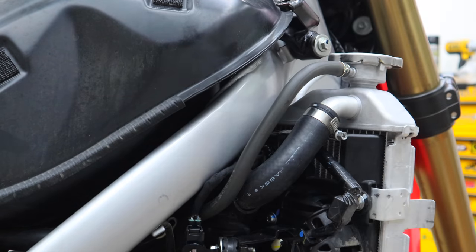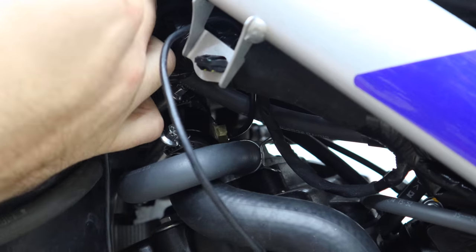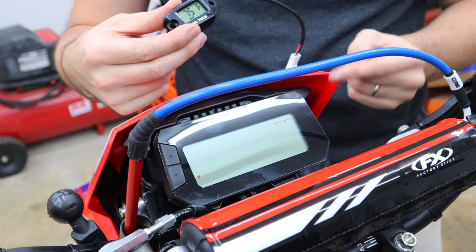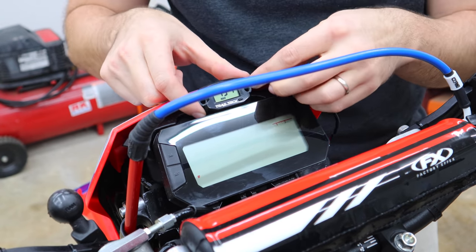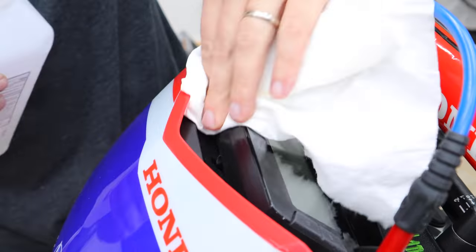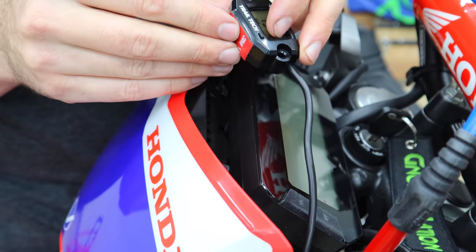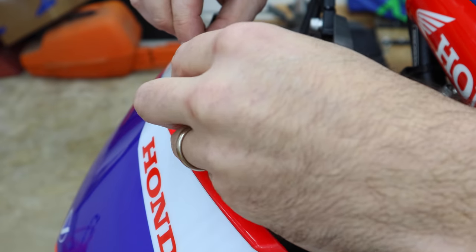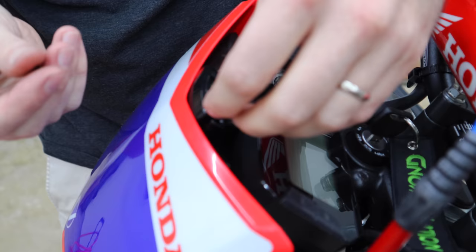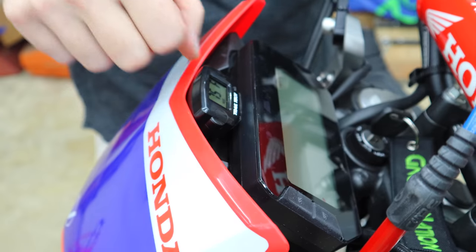There's a big stack of wiring harness wires just above the engine — follow that stack because it goes right up to the dash area. I've routed the sensor cable up alongside it, and with the slack all working out nicely, I'm taking this little gauge unit and tucking it right here on the dash. It honestly looks like it belongs there. Using real 3M double-sided tape, make sure to get it centered. They also include little plastic plugs to fill any unused mounting holes — now it's looking professional.